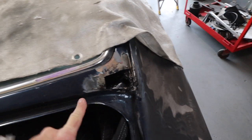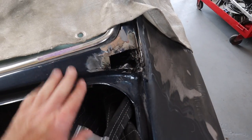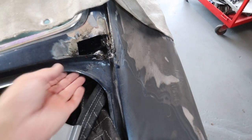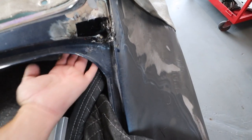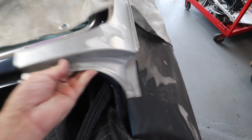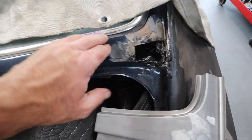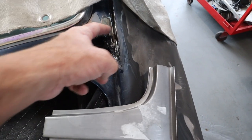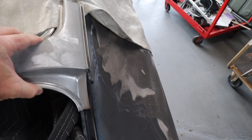We had a big rust spot here, so the first thing I'm gonna do is take the grinding wheel to this and grind all of this away, kind of see what I'm working with. I'm gonna probably have to drill out some spot welds as this is kind of a 3D piece. There's an underside here and this part kind of only goes on top. So what I don't wanna do is have to get into the window molding at all. So I'm probably gonna try to cut this thing here and just trim what I need off of this panel to weld it in.